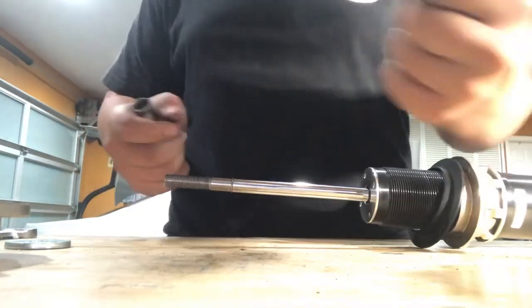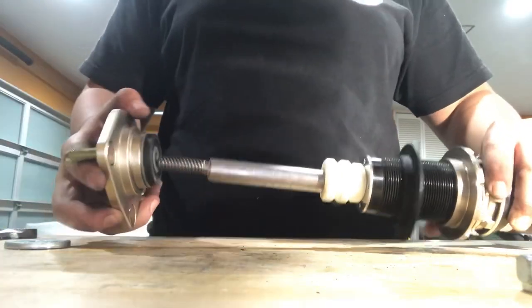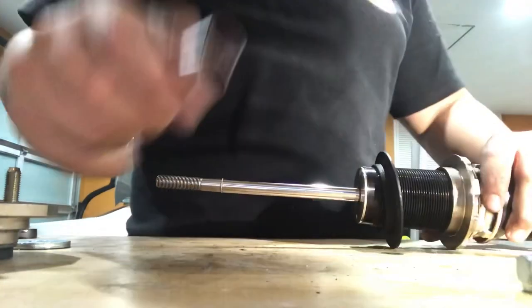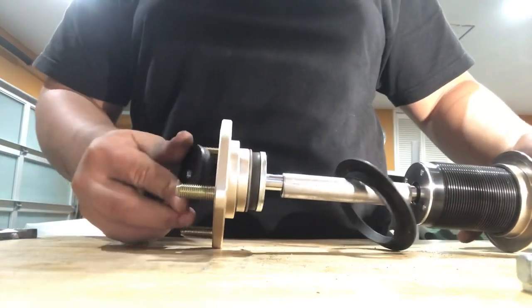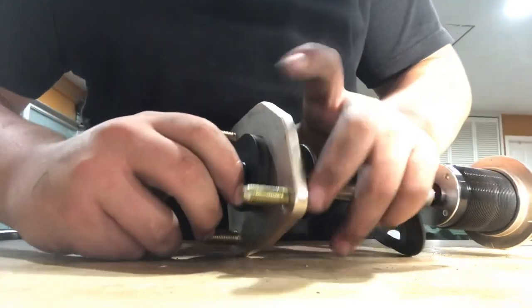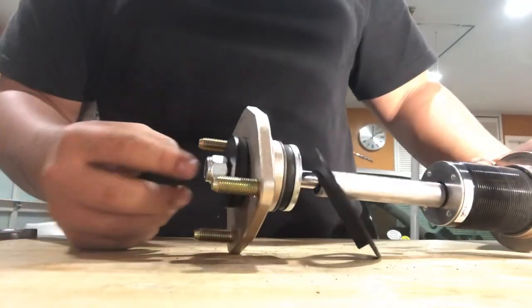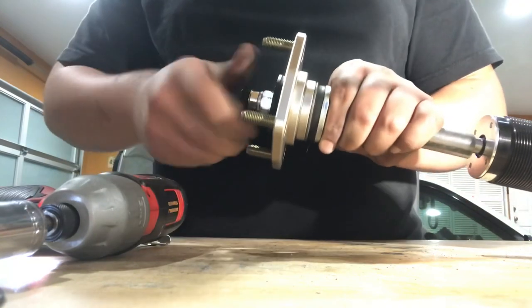This is my four-inch low tube. I found that when you have the bump stop on and then put the tube on and throw on the top hat, there's not enough threading to get everything back on. So what I decided to do is just remove the bump stop, throw the tube on, then put the top hat and the little black rubber piece back on and get it to sit nice and flush. Then screw the bolt back on — I'll use my impact to blast it right on.